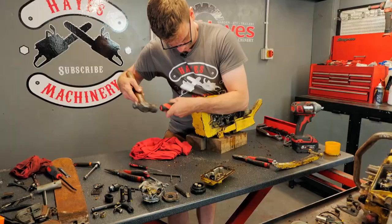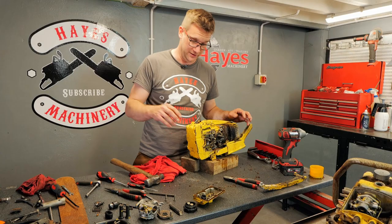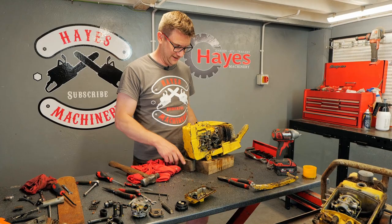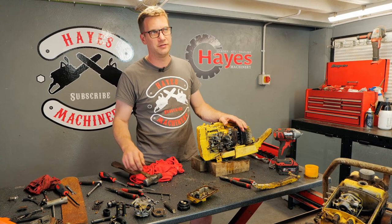Got to get this front case off because that'll make it look pretty. We don't strictly need to take the front case off because the petrol tank doesn't leak, but it's coming off whether it wants to or not. I've also got another one there and some spare screws, so it doesn't matter if I mangle the screws. I might find some nice stainless steel ones, although being a restoration it probably should be flat heads - who knows, we'll work it out.